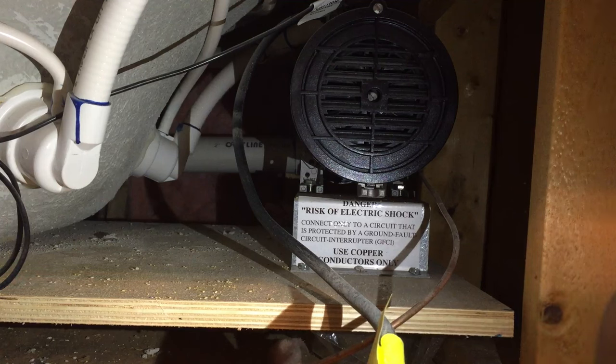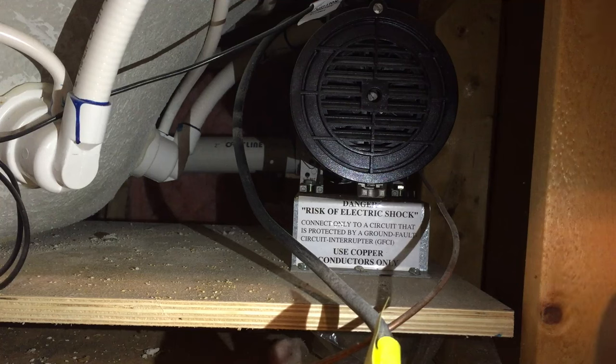When we hear that humming noise, that means the motor is getting power and it's trying to turn on, but the motor itself can't spin. That's usually a telltale sign of any electrical motor — whenever it hums, something is hanging up so that it will not spin.